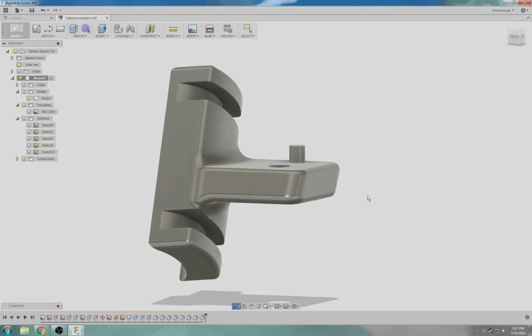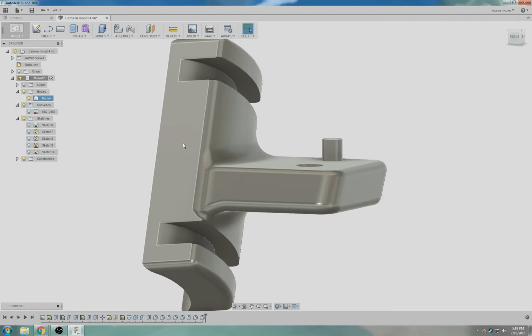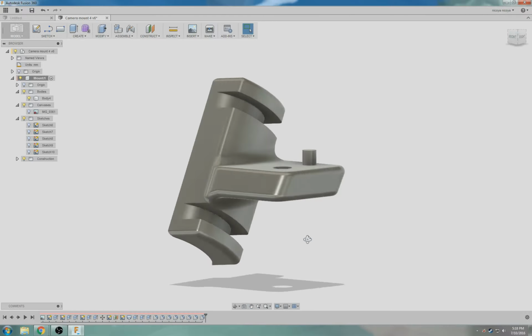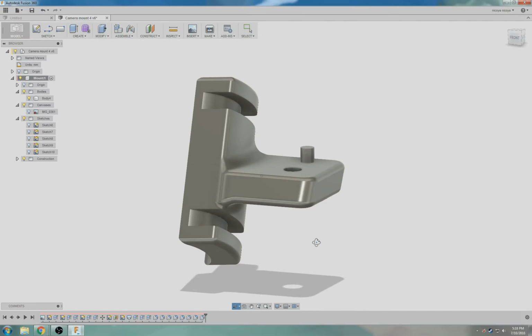And I actually didn't make the bottom one at first, and I only had the top slot, and this just sort of cut off flush about to that plane down there. And I regret that, because when I put on the foam tape and put the zip tie around the top, this kind of kicked out from the side of the fork leg, and the vibrations of going over a wooden planked pedestrian overpass managed to shred the foam tape into basically a bunch of foam crumbs, at which point the entire mount slid down to the bottom of my forks and threatened to spin around the other way and get sucked into my spokes. So don't make the mistake that I did, and make this so that it mounts more securely.